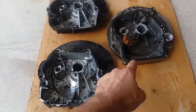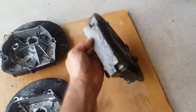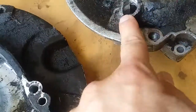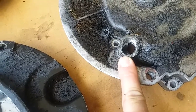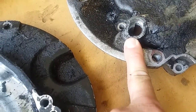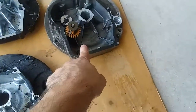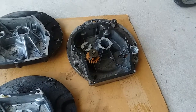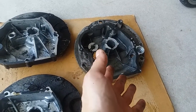And the reason being is this example right here, where someone did this and broke this, where the drain plug screws in. So after they drained the oil out, the plug wouldn't seal. So basically this motor had to come off and a new sump put on it. So pretty expensive repair for something that really you didn't need to do.